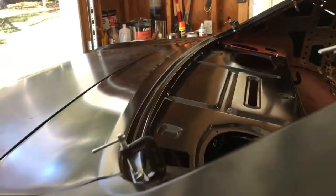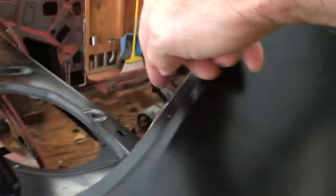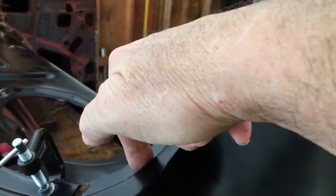So of course all of it's held on with C-clamps and vice grips and sheet metal screws. But I am trying to get from the door back assembled so that I have some dimensional points that I can come back to. This piece here isn't going to move, so I can set the quarters to that, and this piece isn't coming out either, so I can set the quarter to that and basically run the car all the way out to the back and get the trunk lid fit in the gap, which isn't too bad.